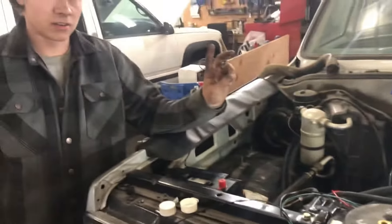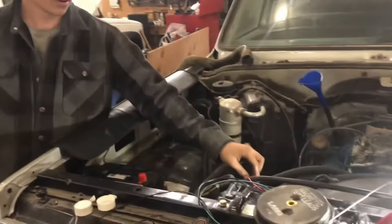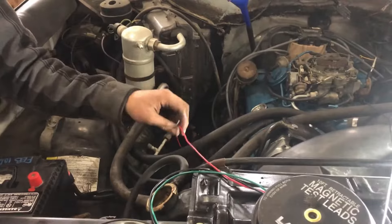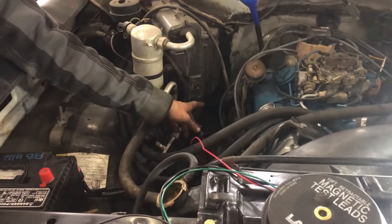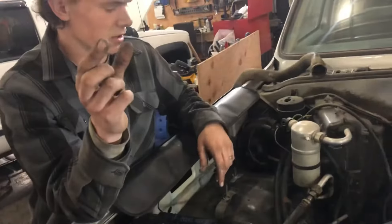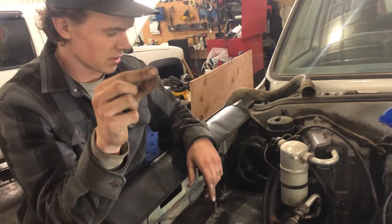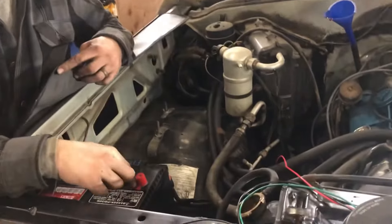All you're going to do is you're going to need two wires. So obviously your battery is hooked up, positive and negative is all good. You're going to run one wire from the right post — there's two little posts on your starter solenoid, the one closest to the block — hook your first wire up to that and then hook that straight to the positive right away.